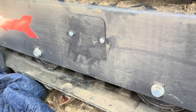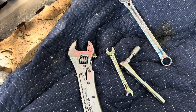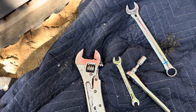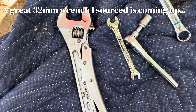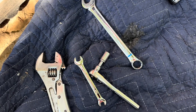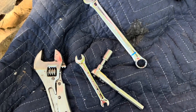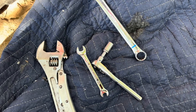Alright, so that's that. I'm going to do the other side. Just to reiterate, you need a wrench that will open up to about 32mm — and I'm going to say it's probably 32, not 31. And you need either a 10mm wrench or a 10mm socket, and a 16mm wrench. By the way, there is a 10mm wrench in the tools box.